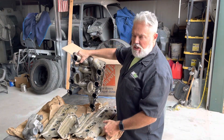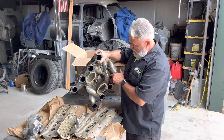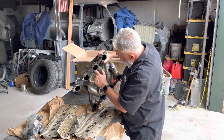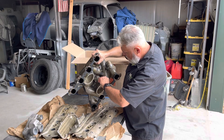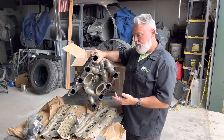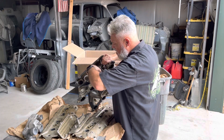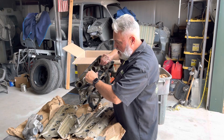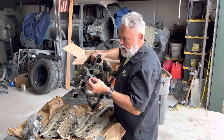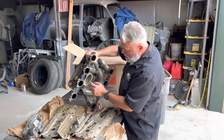This is a GT car — Golf Tango 1990. It's a 4R manifold, so this means it has the problematic coatings on the manifold — or maybe it does not. If these do not have the very tough, hard-to-remove coatings on this manifold, then this will be a first. It appears to come off just like an S4 manifold, so maybe on the GT cars they just put on an S4 type of coating versus the GTS coatings that were on the later cars.